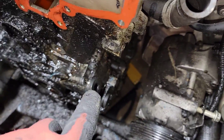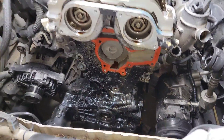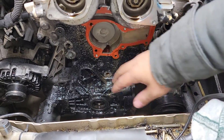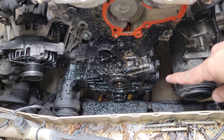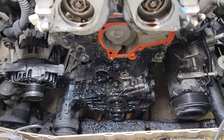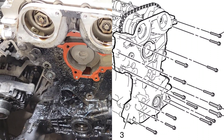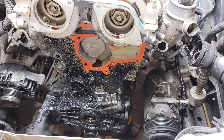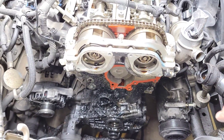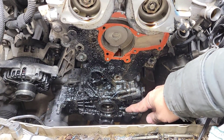All right, there's nothing attached to the timing cover anymore - just the AC pump, the side of the block, and there's the timing cover right there. Everything up here is all free. At the bottom of the timing cover there's probably about six bolts bolted to the oil pan - that's the only thing still attached. The timing cover holds probably 15 or 20 bolts into the block total. First we're gonna have to drain the coolant and then take out the bolts underneath on the front to the oil pan.